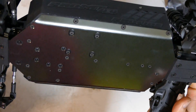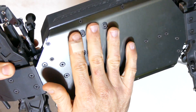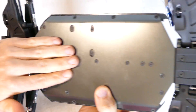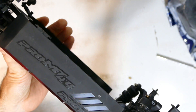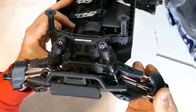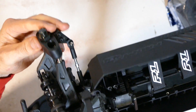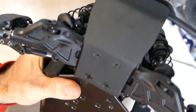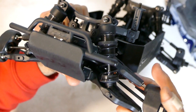This is a 6061-T6 aluminium chassis with a hardened centre spine and raised edges that definitely help with the overall rigidity. The bumpers are plastic and blend into the aluminium part — a cool design. At the front we have traditional pivot ball suspension — tough, durable, and offering a lot of adjustability and tuning. There are massive 17mm hexes, thick A-arms top and lower, kind of filled in as one massive chunk, which should be pretty damn durable.